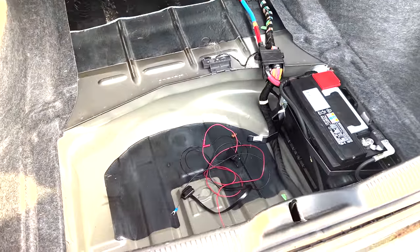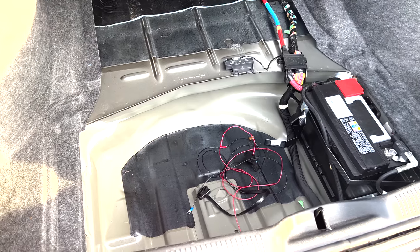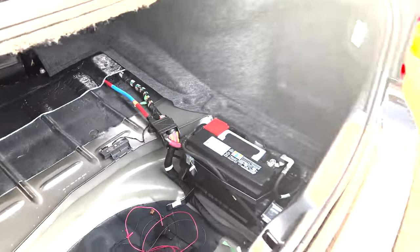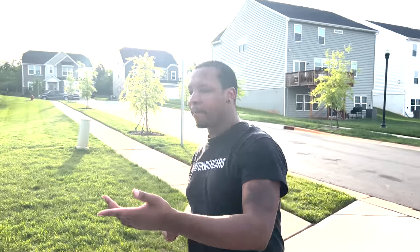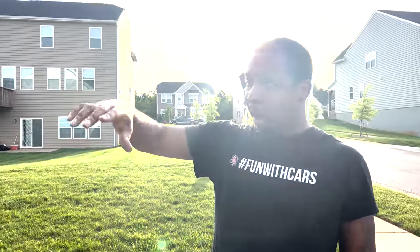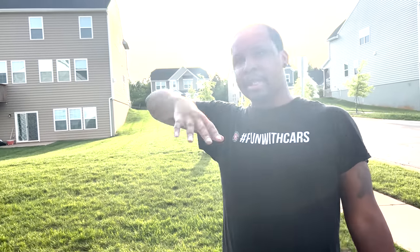But if you go the hardwire route, there's a chance that you may lose your engine start and your vibration, because technically it shouldn't read the engine start coming from the battery, because it's just plugged into the battery. Well, I'm thinking it should read it based on the voltage change. Yeah, because it's going to get a baseline of your voltage as it's plugged in. And if all of a sudden it spikes up to maybe 14.9 when it's running, or something like that, then it's going to notice that the engine's probably cut on.